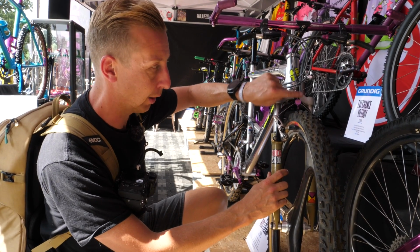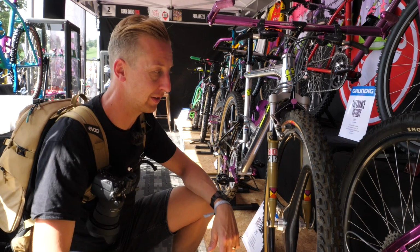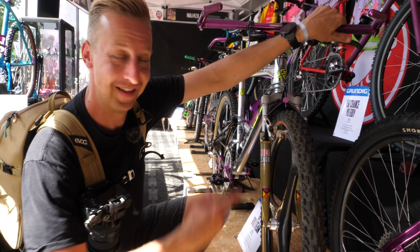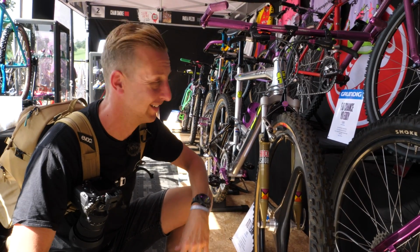So you had to have the optimum setup between how high your straddle was and where the post on the brakes was. And you could never get them identical. As you can see by these ones here, that one's not even pulling in properly. Nightmare, they always were. Terrible things.